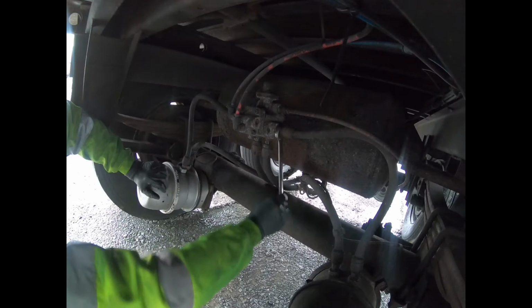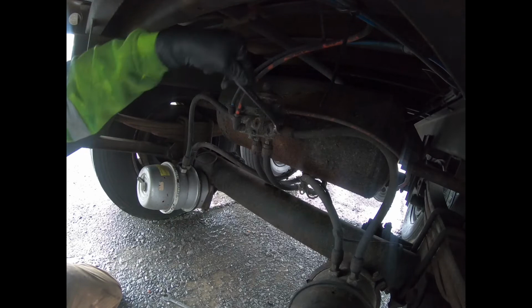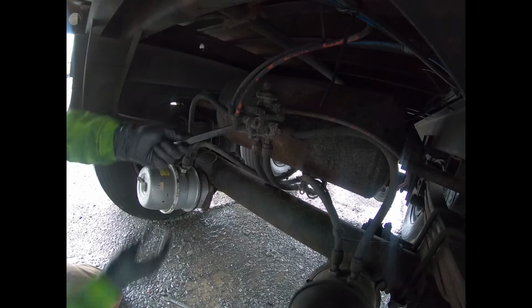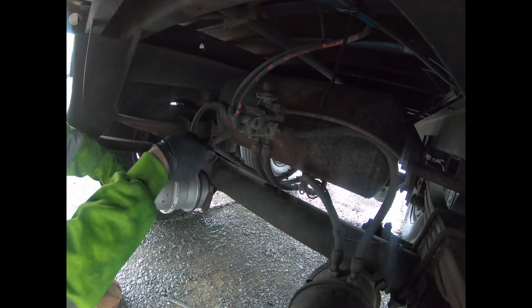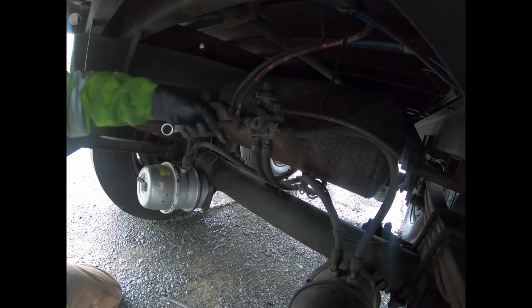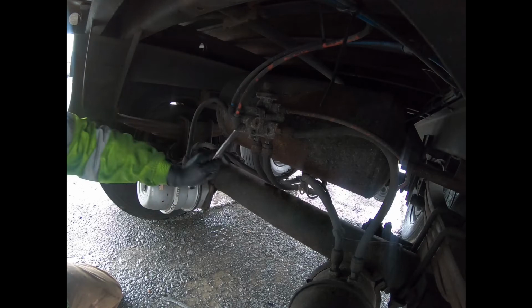Especially these northern trailers, which I'm here in the south, but these trailers that come up through the north, you can kind of see some of the rust and corrosion here. It's pretty nasty. Luckily this one's not too bad, but the tank is quite rusty. Springs are rusty. It looks like it's actually had brake work done on about every axle. It's like fairly new shoes on all but one hub, which is strange. I don't know why you wouldn't just put all new, but sometimes some companies do weird stuff.